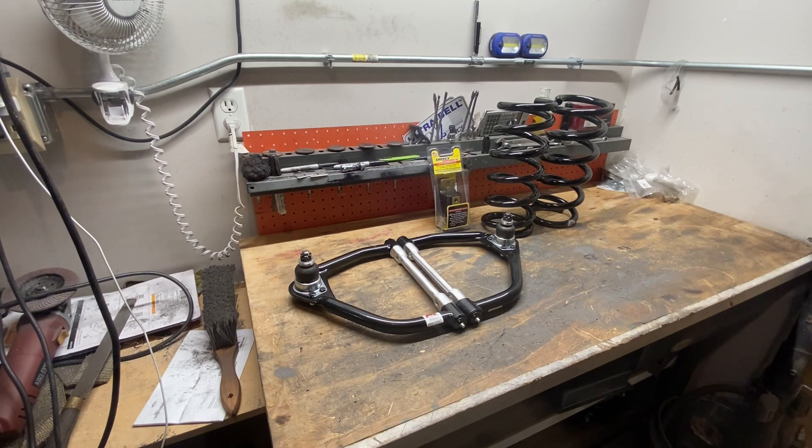What I was trying to do was look at the spring rates on the Moog website and get a good idea of where I'd want to start. I ended up going with the four-cylinder springs, which I'm hoping will give me a slightly higher front-end height than I have right now and still store enough energy to allow some front-end separation on takeoff. With my current cut springs, even if it tries to transfer weight, there's nothing to support the front end — it goes up maybe half an inch and falls right back down.